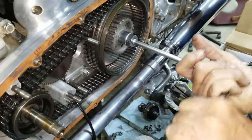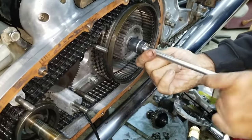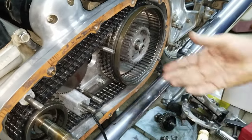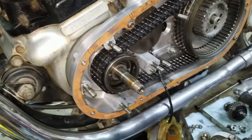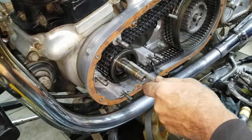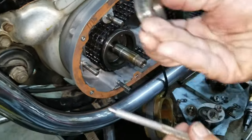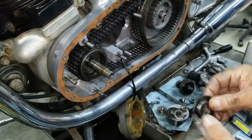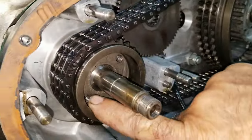This had Loctite on it, so it's kind of snug. Okay. Here we go. Now we've got to have the puller here. We've got to get this out of here. Here it comes. There's another piece that's back there, and this always has to lay with these grooves facing outward, not inward. That's part of the oiling channels. Now there's two threaded holes here, one here and one there.